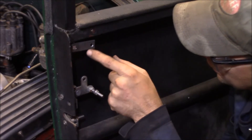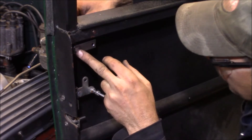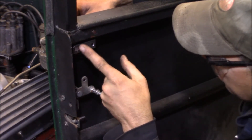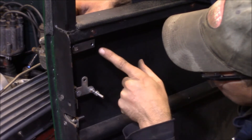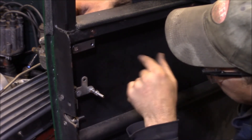So here's my operating arm — it's just made out of a piece of three-quarter-inch flat stock. I've also shortened up the square part of the door handle to get it back behind my door panel. So I'll weld this on here on the end, and then this is drilled for a one-quarter-inch bolt, and a piece of flat stock will go between here to here, and it'll bolt together and be my linkage.